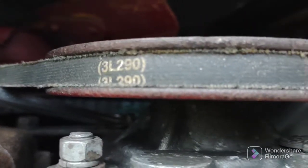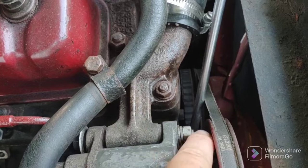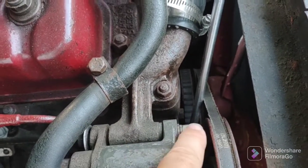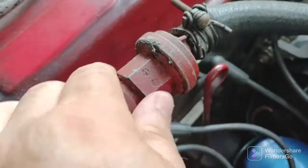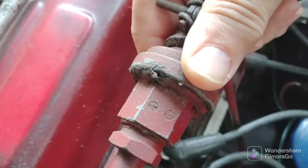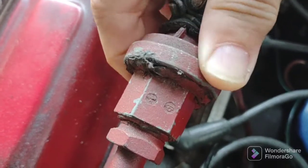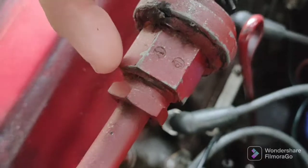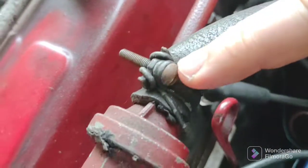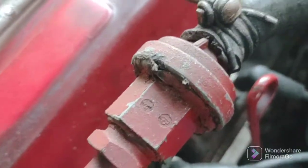Here's my air pump belt — it says 3L290, and 29 means 29 inches. I have my closed-end wrench on the tensioning bolt down there, and then you have your pivot bolt here. It's about a half inch on each side — 12 or 13 millimeters or half inch. This is the check valve and it looks like someone tried to seal this. Exhaust is getting out of here — it's not working. Either air is coming out or exhaust is coming out. You have to hold this, loosen this clamp, then hold this with a wrench while turning the other part and unscrewing it.